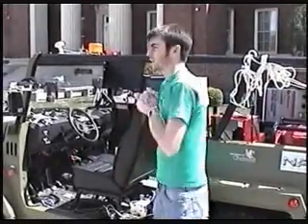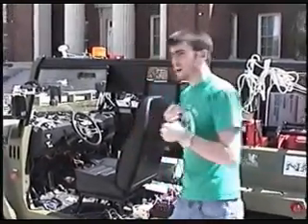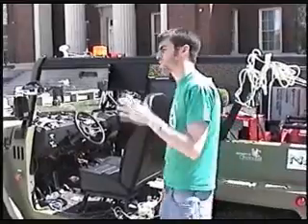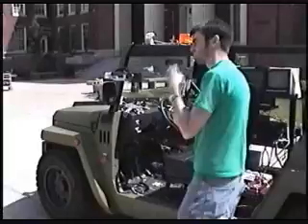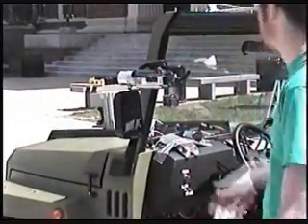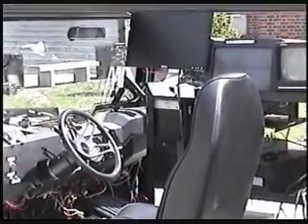My name is Scott Reynolds. I'm a member of the UC Robotics team, and I'm going to talk about the various sensors and computer systems on board our Jeep. Our Jeep is designed as a distributed complex system, where each PC is responsible for a small subset of sensors, and they combine together to produce a full working system. One PC, for instance, is responsible for controlling the motor controller. We have a laser scanner used for obstacle detection, various camera systems mounted on top of the Jeep for line detection and road detection, and we use GPS on top of the Jeep to keep ourselves on our path.